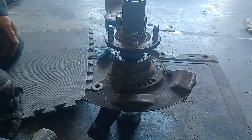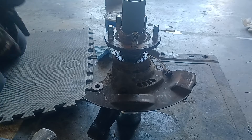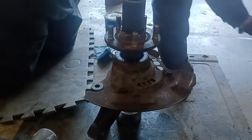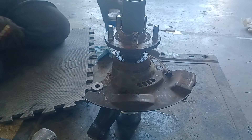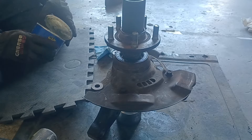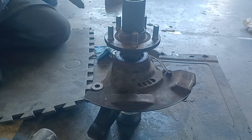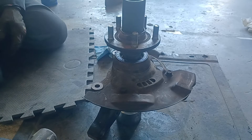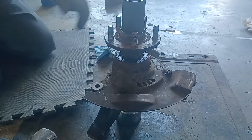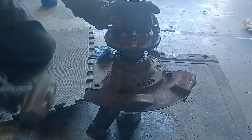I don't think I'm forgetting any details here, but lastly we'll put the other seal on the back after we're done. Oh, and by the way — I take these bearings apart and put marine grease in them to make them last a little bit longer. They only come with a little bit of that white lithium-style grease, and that doesn't seem to last very long in these bearings.